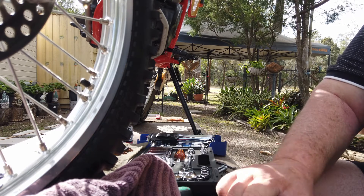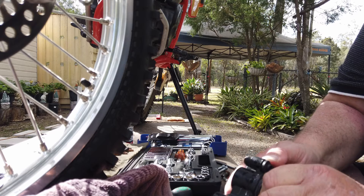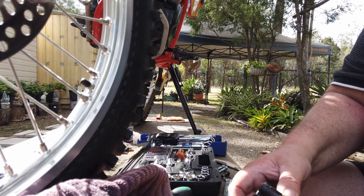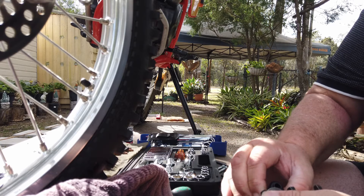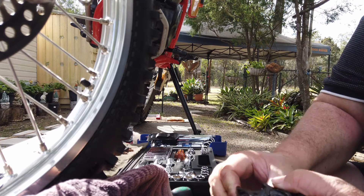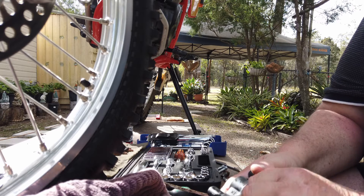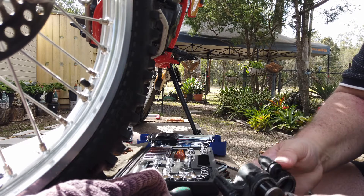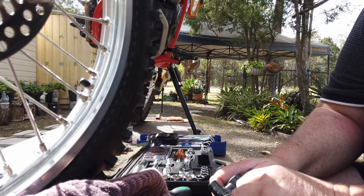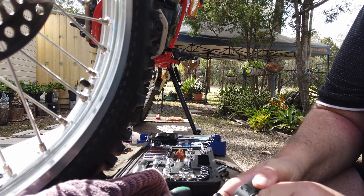This part here can come out as well now, so you can get to your pistons a lot easier. Just wiggle and wiggle — I can feel movement in there so eventually they'll come out. Don't use a screwdriver and pry them out like that otherwise you'll burr the sides on them and they'll be stuffed. As it turns out in this case I'm putting new pistons in as well, but I'll do it the hard way to show you it can be done.